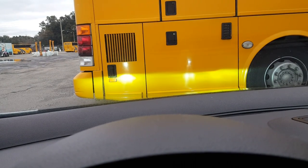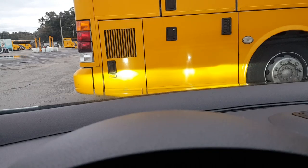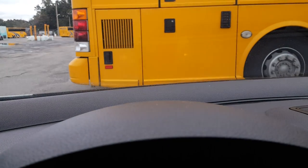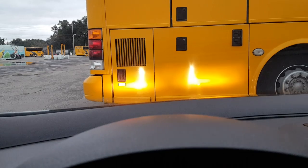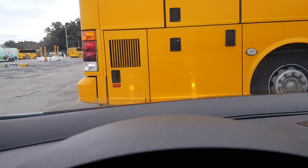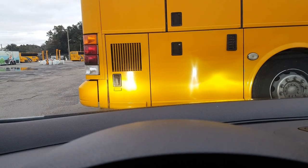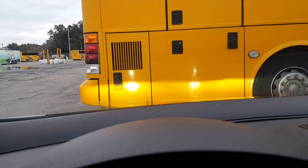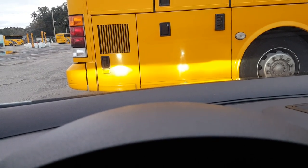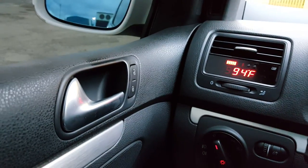When your headlights are on, it just opens up that little flap. If you put it on city lights, you can have your fog lamps on and still have the flash-to-pass option. If you have them all on, I thought the fog lights would turn off but they still come on. It seems the flash-to-pass only works when your headlamps are not on — at least on my setup.